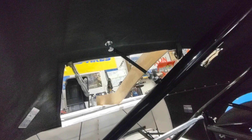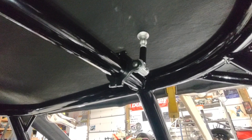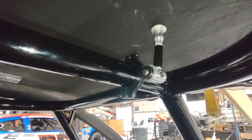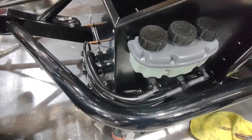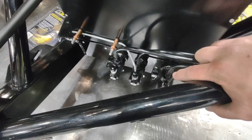There are lighter ways to do it using adjustable body supports, but I don't think they're as firm - they tend to slip a little bit. I also designed this little fixture right at 10 inches back where they measure your roof height at 47 inches, to ensure that's never going to be an issue. I just took a couple of spoiler supports, cut down the piece in the middle where you threaded it - the top one's right hand, the bottom one's left hand - used a Joe's accessory mount, worked out pretty good. You can also see our reservoir setup - that's the Tilton small reservoir with number four lines and the Tilton 76 series master cylinders with a male four-to-four fitting and a copper washer to ensure they're sealed.